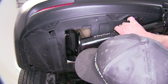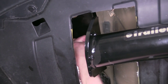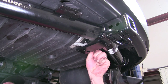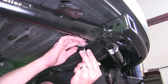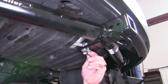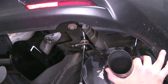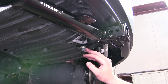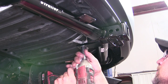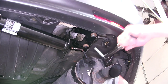We'll reach through the panel and install our bolt and conical tooth washer. Keep in mind that as we install our fasteners, we'll just install them finger tight until we have them all in place. Once the weld nut hardware is in place, we'll move to our U-bolt. With all attachment hardware in place, we'll tighten everything down, making sure to tighten both sides of the U-bolt evenly. Then we'll torque to the specifications indicated in the instructions.